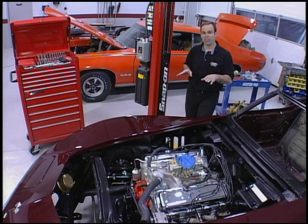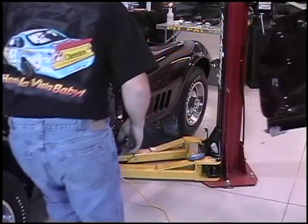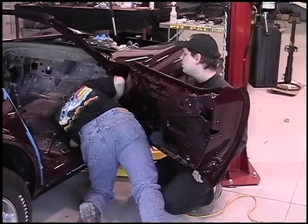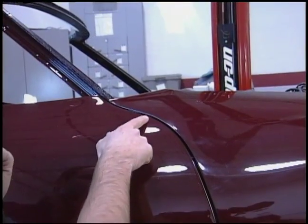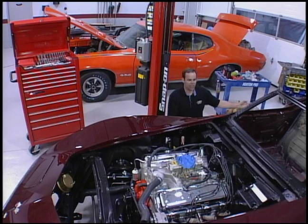Once the body is set down on the frame, there are shims. Originally we marked the original shims on this body as it came off, and then on the jig we built, we added that height to make sure as we did all our body work everything would fit. As we start putting those shims back in, we're adjusting the doors. The easiest thing is to start off on this door here — the door and the fender aren't going to change position. These two shims should be at their lowest point, and then you make sure that the door lines up nice and straight with the fender. Once that's done, you're doing all your adjustment with the rear of the door using the body — you can actually raise the body up and down, closing up the door gap or opening up the door gap as you need it with shims on the back mount.